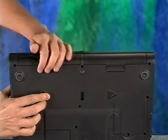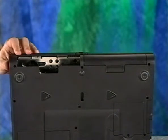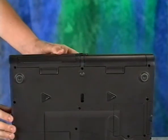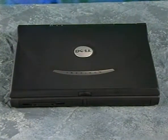Slide and hold the latch release with one hand and pull the device out of the media bay with the other. Install the CD drive in the media bay. When it's in place, you'll hear and feel a distinct click to let you know that it's been installed correctly. Return the computer to its normal position — that's it! You're ready to restart your computer.